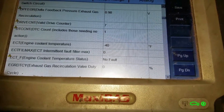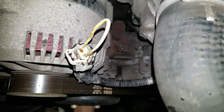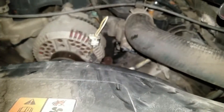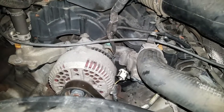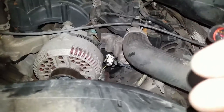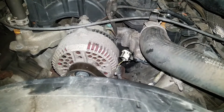It still said negative 14 degrees, which is wrong — I unplugged it and the thing had been leaking for a while. Now I've got the right value: it's maxed out at negative 40, so it must have had a slight connection somewhere between the plug ends. I put a jumper on this plug and my coolant temp ran at 318 degrees, so I maxed that out — I know this is the right sensor and it's not a wiring issue. I'm gonna replace that sensor and do an intake manifold. The upper intake manifold has to come off just to replace that sensor anyway.